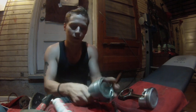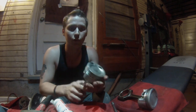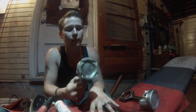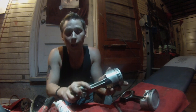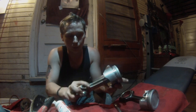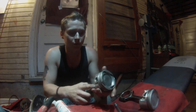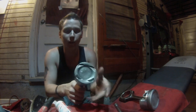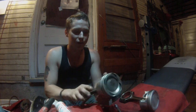On startup it will make a noise that sounds like a rod knock — don't freak out. This is a floating wrist pin, so it'll float a little bit; that's called wrist pin slap or piston slap. Once the engine warms up and oil circulates it will get quiet, I promise. It freaked me out the first time I heard it.